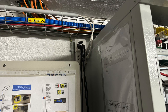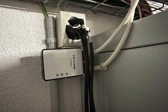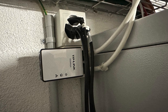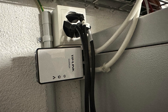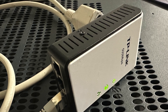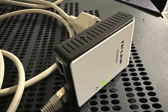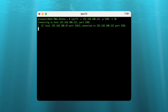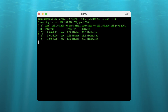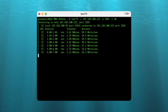I wanted to use that wall plug up there. While it still is on a different circuit, it should fare better. Unfortunately, due to the other cables plugged in, the Powerline adapter couldn't be properly seated. So I quickly hooked it up on an extension wire, which again is not recommended best practice. At least it would synchronize to somewhere around 66 megabits, giving me a much better transfer rate of roughly 29 megabits actually pushed through, with a lot less spread in the test results.